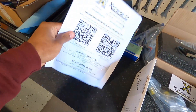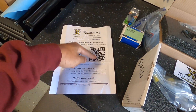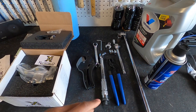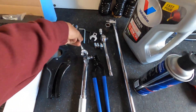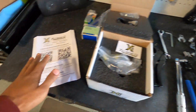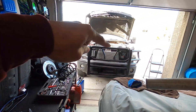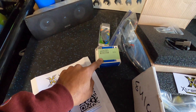When you get your fuel pump, you'll have this installation paper which gives you a written version as well as a YouTube video, which I'll link below. That manual gives you a full list of tools you'll need: torque wrenches, line wrenches, crow's feet, different size sockets, wrenches, breaker bars, and Allen wrenches. They also recommend getting a new roller tappet from Ford — that's at the bottom of the pump, on top of the cam lobe, and it's what pushes the pump up and down. They recommend replacing it while you're in there.